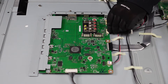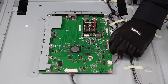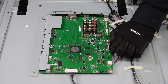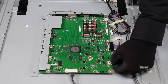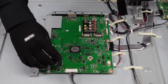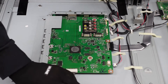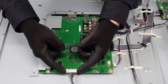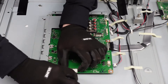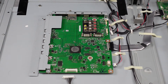Same thing with this one right here. This cable right here, we're going to pinch down on the two little buttons on the side, which unlatches it — that should just walk right away from the board, no problem. This is going to be another one where we push down on the lever on the top. This one right here is similar but a little bit different — we're going to pinch down on the right and left side at the same time, then walk that away from the board.